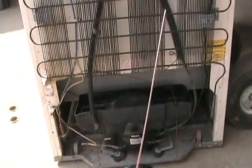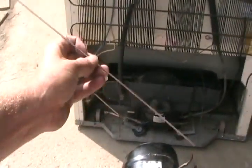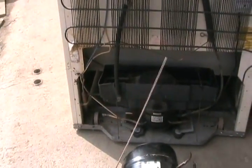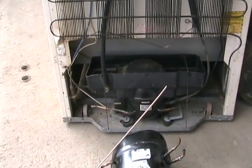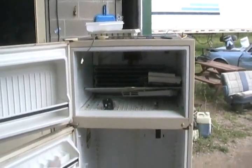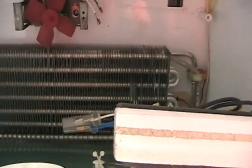All the leaks on the outside of the fridge and on the back are very easy to fix with a piece of Silphos or silver solder and paste. I like Silphos the best — this stick's worth about two bucks. It doesn't need any paste or preparation as long as the tubes are fairly clean; you can just weld it on, but you definitely need a high-temperature torch — a regular propane torch won't do this. In most circumstances it's leaking around the door frame, so good luck trying to fix that. And good luck trying to fix an aluminum evaporator.